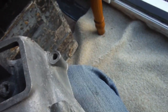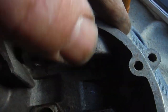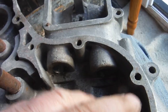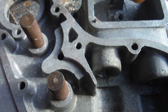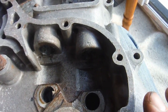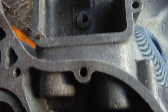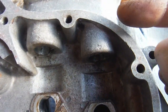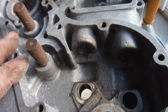Back to the rocker feed and relief valve system: once the oil has either been to the rockers or bypassed through the relief valve back into the timing chest, it oils the camshafts and cam followers and everything. The British engines pump it back through that hole, or in the Indian engines it reaches a certain level and returns to the tank. So the scavenge pump doesn't pump anything directly back to the tank - it pumps it all to the rockers, with any excess pressure or oil bypassed straight back to the timing chest on British engines.